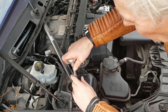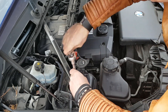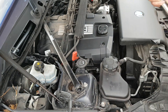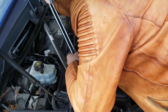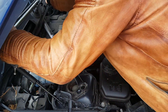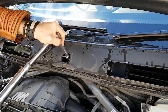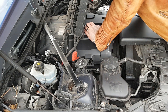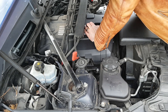Sometimes the tray needs a bit of a pull as it gets stuck to the rubbery bit behind, but it came off without any problem this time. Then there are two big torx bolts - they're male torx and need a female socket. Quite a small one here, and it doesn't take much effort to get that one off. The one in the middle is a bit harder, so I'm using an extension - part of a microphone stand - on my wrench. It's much easier using a long extension because you can just lean against it and it will undo. Those are done up pretty tight so you need a bit of effort.